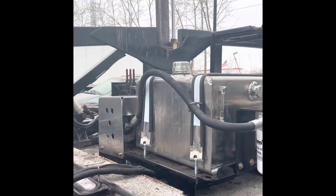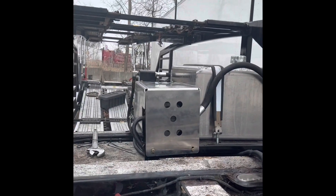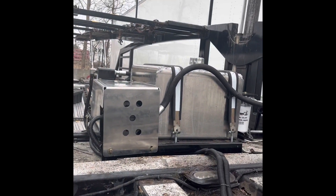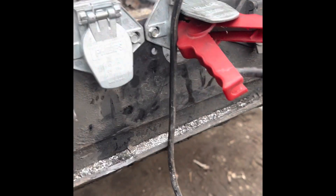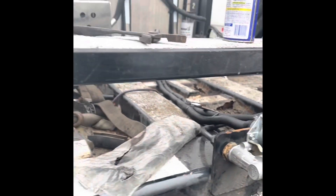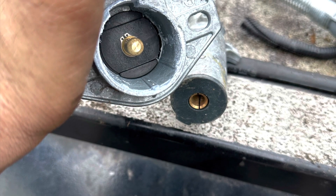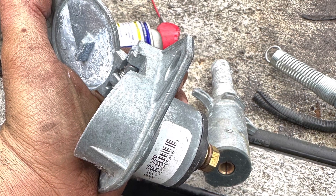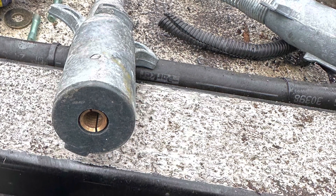There's a big filter here on this side, and the motor is right there. It's covered, and I put the two electric wires — black and red — here. Make sure to get those connectors, male and female, from any trailer or truck parts store, to hook your two wires — black and red — from the motor to the trailer, and then from the trailer to the truck, to your battery.